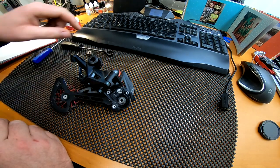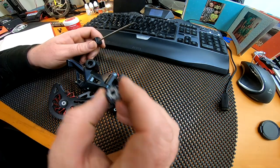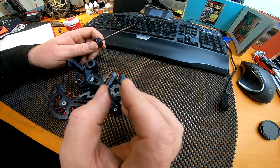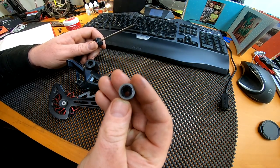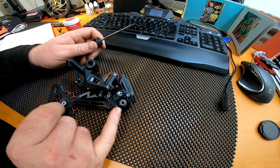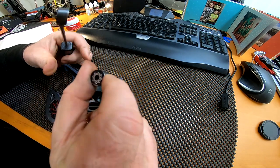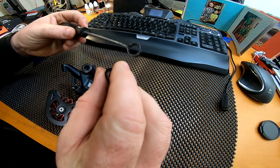This is a spring, and what it does is put more tension on this one-way bearing, which in turn is what gives you your clutch. Inside there you've got a set of needle roller bearings — they will only turn one way. Due to that, the needle roller bearings go on that shaft, and that shaft will turn freely now that I've taken this off. So we know the issue is not in here; it's got to be within this or this.